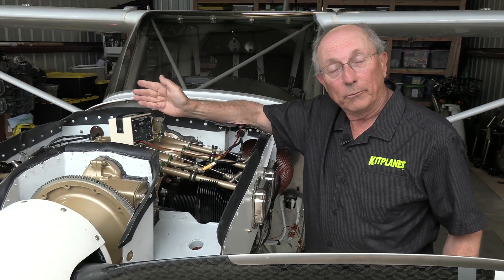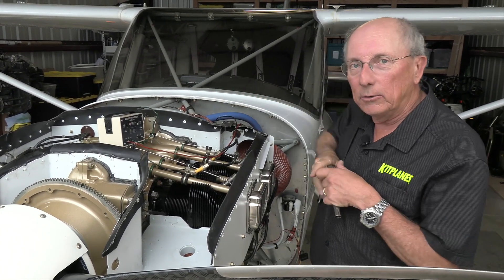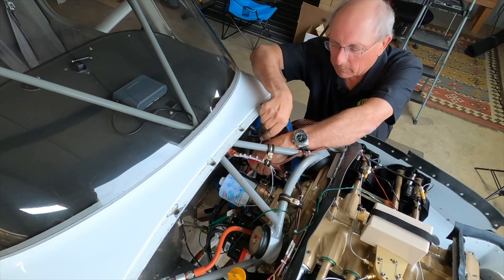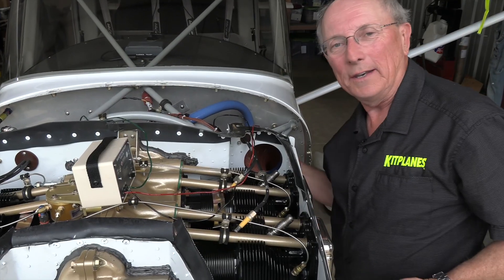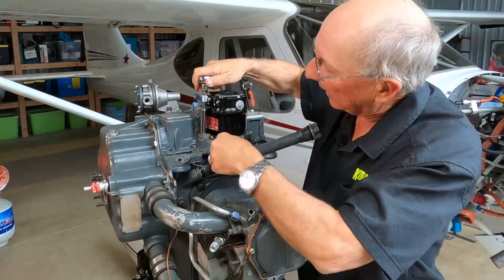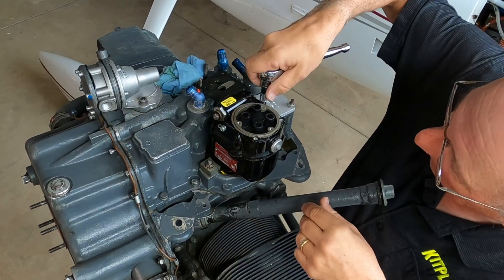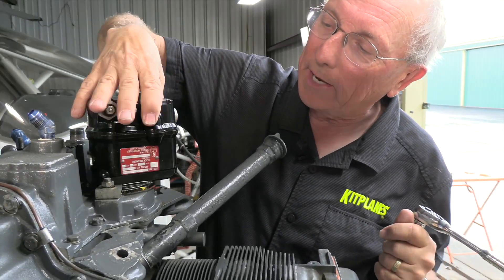This engine is timed perfectly, but what if it wasn't? Then we'd have to adjust the timing. We do that very simply by moving the magneto — just twist it a little bit. The magneto is held on by two studs with two nuts. You have to go in and loosen those up. Depending on how much room you've got between the back of the engine and the firewall, it can be easier or harder — there'll be one nut on top and one nut buried amongst all the hoses. On our spare engine you can see things a little better. The magneto is attached with little clamps and a single nut that holds it onto each stud — one near the bottom and one near the top. All you have to do is loosen those up just a little bit. You don't want to take it off because you want the magneto to have a little resistance.